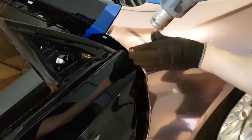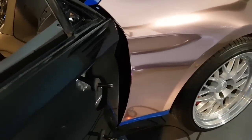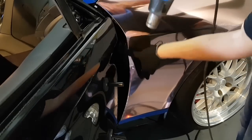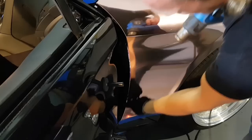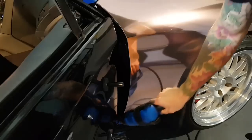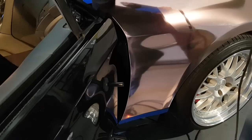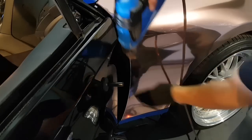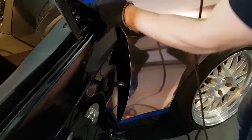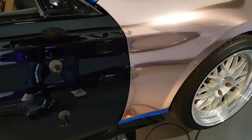Finish off doing the door area, straight down, which is this inside part. I usually go over it with a bit of heat first, and then I'll gradually bring it in, not all the way. Go over it again with a bit of heat first, gradually bring it in, go over it with a little more heat, and probably finish it off right here. All right, we're going to post heat also. That's that. This panel is completely finished right now.